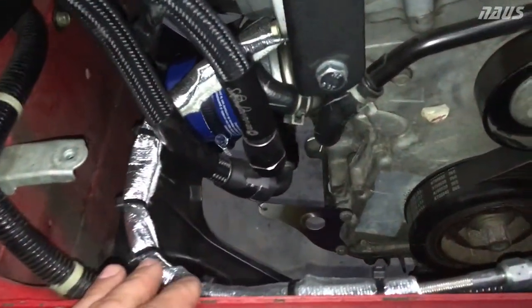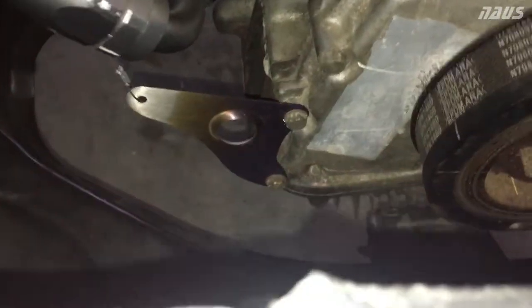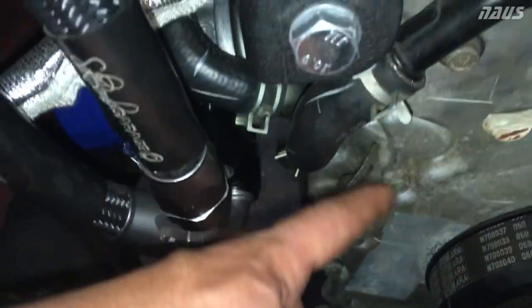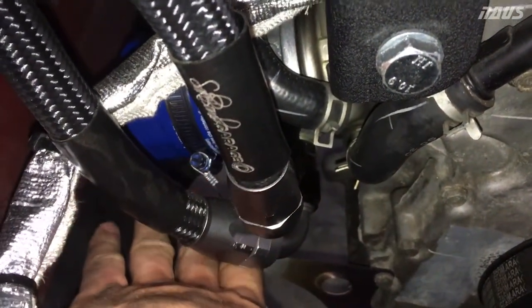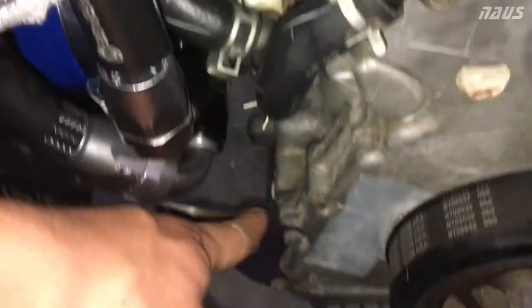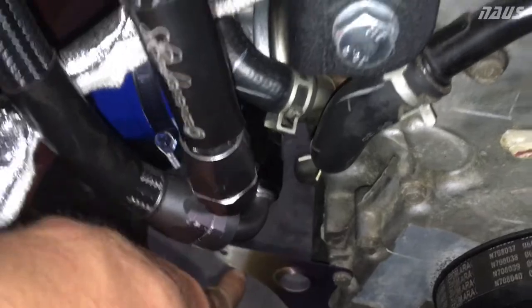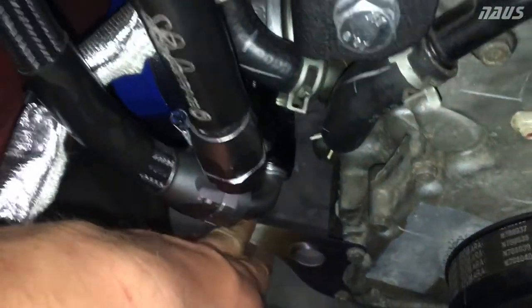But this is just adding to the cluster. It is the oil filter stopper kit from Renegade Motorsports, and on their website the thing is designed to mount to these top two holes and extend right over to the oil filter that way. I did not mount it there just because this piece on the bottom, when you flip it upside down, was contacting the Sakebomb 90-degree fitting, and with vibrations I didn't want any metal-on-metal contact.